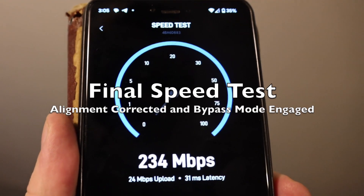Now that I've done bypass mode we are getting 234 megabits down, which is double what we had before — we were only 100 max, and that's the most we could get here. Long story short, they couldn't go any higher without us putting up a tower. I assumed our equipment would recapture an IP address, but our current firewall was holding on to an old IP and wouldn't let go. Switching it off and back on — specifically setting it to bridge mode and then back to addressed — caused it to restart the internet connection to Starlink.